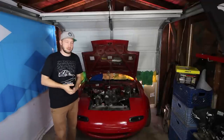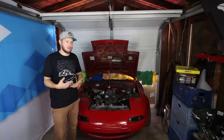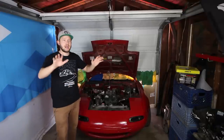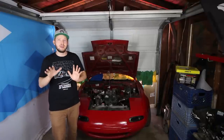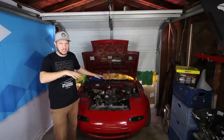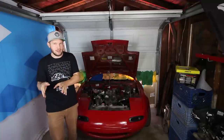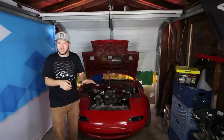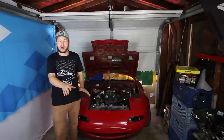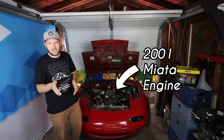Now, if your car starts in the morning and runs on three cylinders, this might be your issue. Or if you have a loud ticking, that might also be your issue, as your lash might be too big. Now, do not get that confused with the ticking issue on the earlier Miatas. What I'm going to show you in this video today has nothing to do with 1990 to 1997 Miata engines. Those have hydraulic lash adjusters, and this procedure is completely unnecessary, pointless, and won't do anything. But if you have a 99 to 2005 Miata engine, this video is for you.